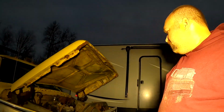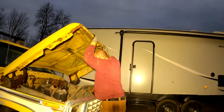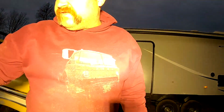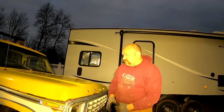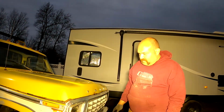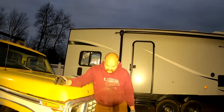But cool. Well, we know it runs. The engine sounds healthy. He's just going to need a little bit of love in the carburetor department. I'm not going for a restoration on this, so I'm probably just going to try and delete that emissions stuff, the EGR and all that. It just makes it so much easier to work on. You don't have those vacuum lines and all those leak potential problem sources. I know that's like the old dumb redneck way to do things, but you know, when you're the one trying to troubleshoot stuff, it's kind of a different story.